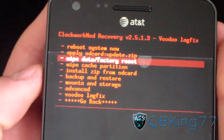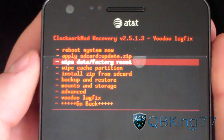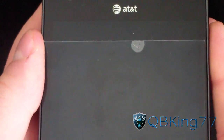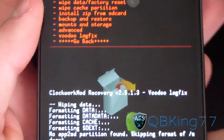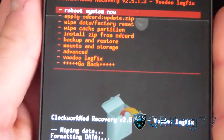After you make an Android backup, go to Wipe Data Factory Reset. I always recommend a clean wipe before installing another ROM, unless specified by the developer otherwise. So delete all user data — this will delete everything: your contacts, your messages, your apps, etc. So back everything up with an app or whatever you use.